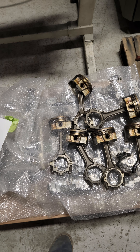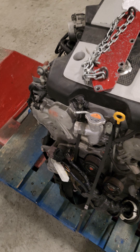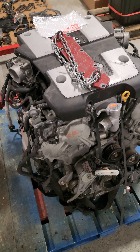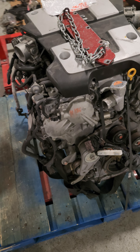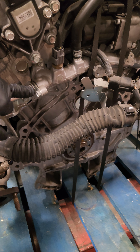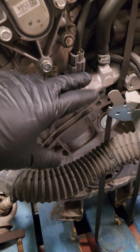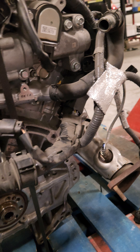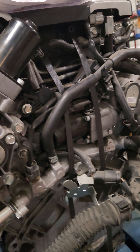If you're sending a core to somebody to build, one good thing you can do is be like this guy. I don't know where this engine came from, but visually and externally it's a solid core. I've got to tear it down and look at it, but you don't see any broken connectors. These guys wrote down their compression numbers, so this is a very legitimate VQ37. Other telltale indicators: no white coolant chalky stuff. It's just got some dust and oil vapor.